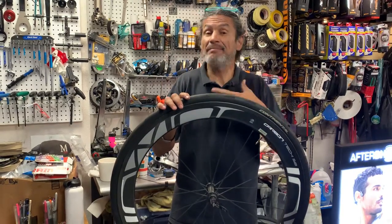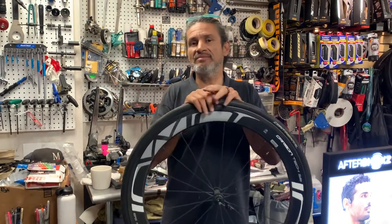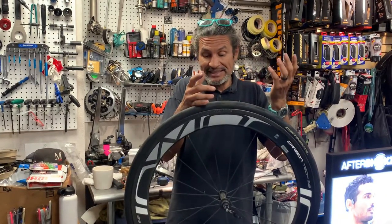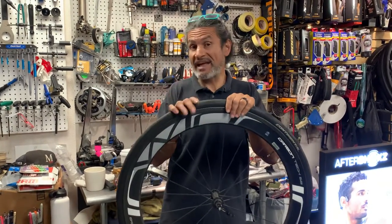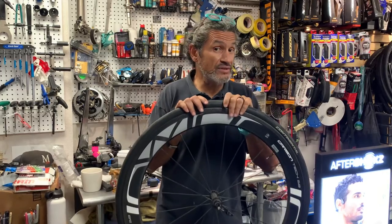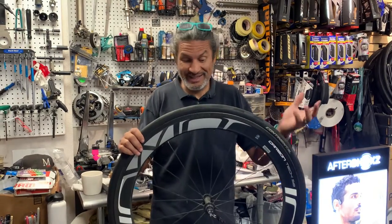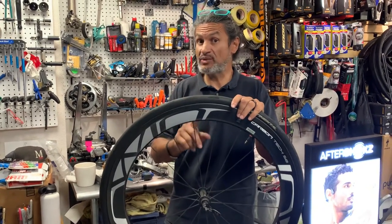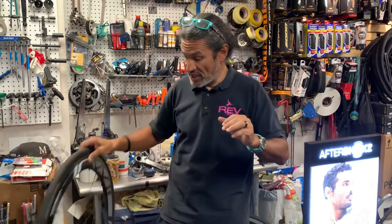There's a lot more give to a wheel with longer spokes. In my opinion, the deeper you start to go above 50 millimeters, this is pretty much an all-out race wheel that for everyday riding is probably too much. It's probably not manageable in crosswinds, and it's probably heavier than anything else you could have ridden on your bike. But there is always that aerodynamic advantage. You have to pick what is most important to you, and you can get these wheels much, much deeper than this.